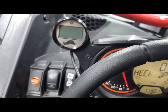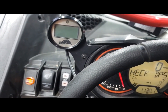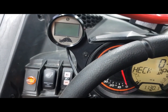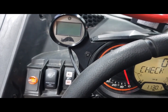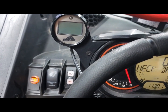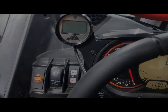This is Jim with Evolution Powersports. Today we've incorporated some changes into our tuning — all the tunes — that has to do with the way the intercooler fan works. The factory setting has it come on at about 8 pounds of boost pressure, and then it will shut off once you return back to idle or you're off the gas for any period of time.